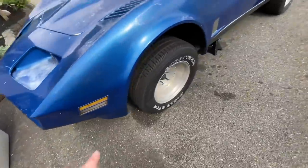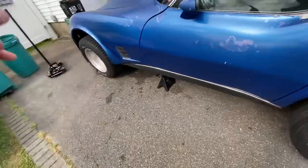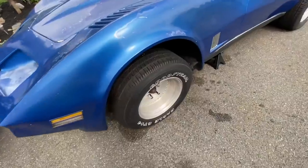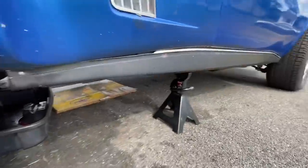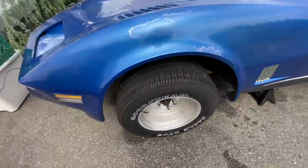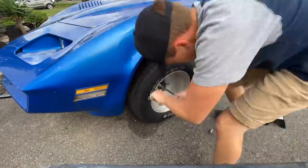What I'm going to do right now is jack up the front a little bit, then jack up the rear and put jack stands under there so all four corners are off the ground. I need to take all four tires off and bring them to the tire shop. Unfortunately my truck is getting inspected right now, so I might have to make two trips in a Honda or something. I want to raise the front up first since when the back goes up, this end may come down a bit.